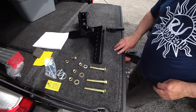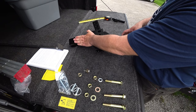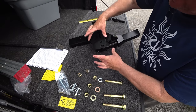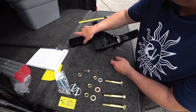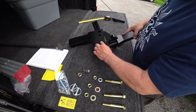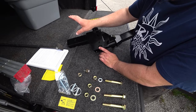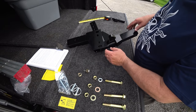In my case, the difference between my tow vehicle height — where this is going to slide into the receiver tube — and the hitch bar height is four inches. So my plates are going to be down. You can see the plates are mainly down from that receiver tube; if you flip it upside down they would be mainly up. What they're trying to do is help you determine which hole you need to be at without the head assembly already mounted. Whatever the difference is between your tow vehicle number and the hitch box number should be roughly the same.